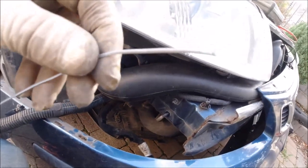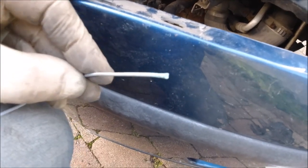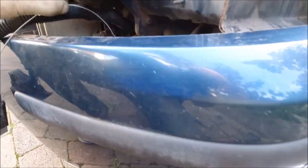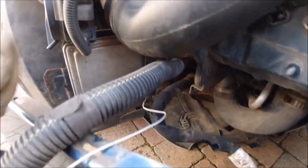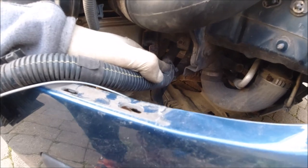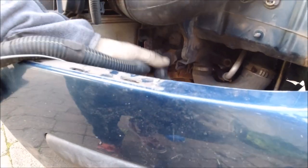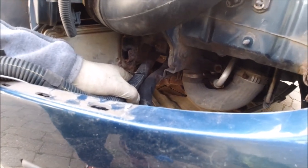the cable was, ta-da, damaged. Look at this. Green inside and it is damaged somewhere there on the corner. So at the moment, okay, fine, great, we found the point why the relay is not working, because the signal from the ECU is not coming to the relay because the loom is damaged. So we have to fix the loom. So now I have to strip it a little bit more and find the place and fix it.